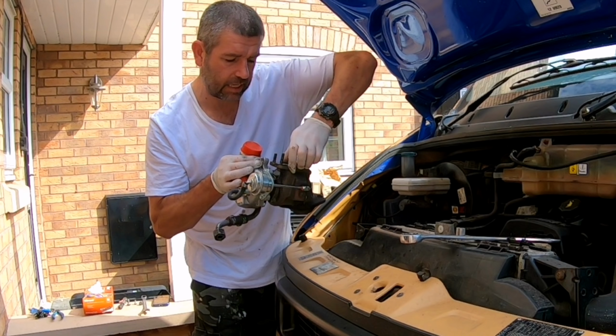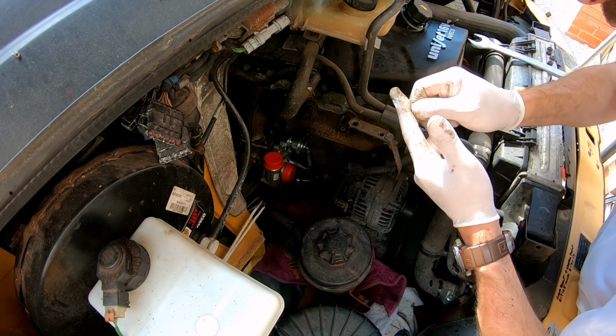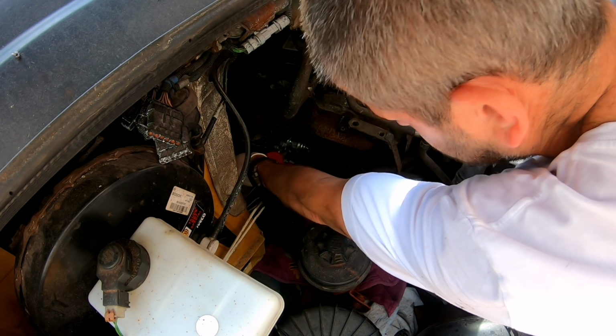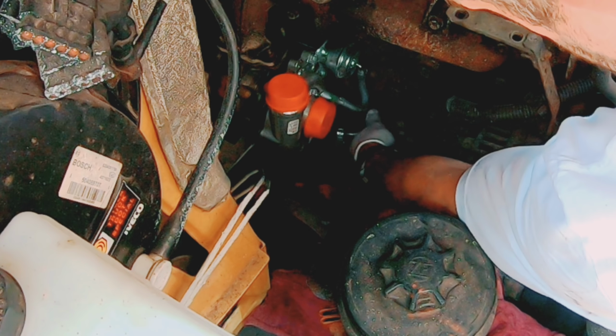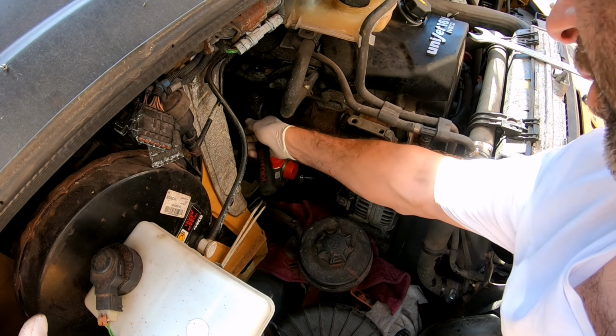I have put a gasket on the exhaust manifold mounting point. So that's put in its place on top of the manifold mounting point itself, or underneath should I say, and now I can start bolting everything back on. So I'll put the washers back on, get my finger out the bloody rubber glove. There's four washers on each mounting bolt. So get them started. Put the hose down there to reconnect the oil return hose. Just tightening up the four nuts that mount the turbo onto the exhaust manifold itself.